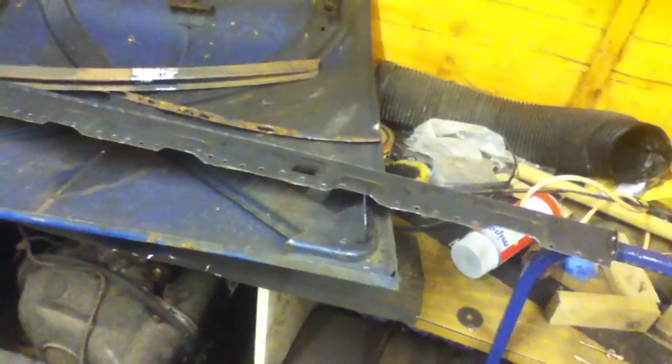New sill to go on - all drilled, ready for plug welding. That'll be when we've sandblasted the sills. The bonnet - that was the old panel there, had it as you can see. So I've got a new panel, just needs welding on. That just needs welding on - a couple of plug welds, that'll be alright.